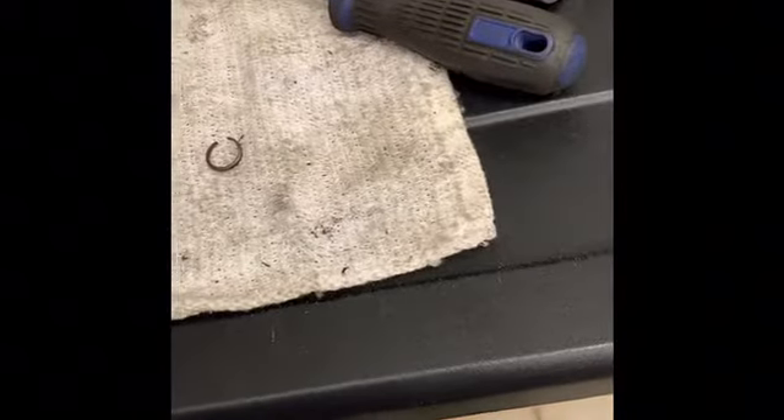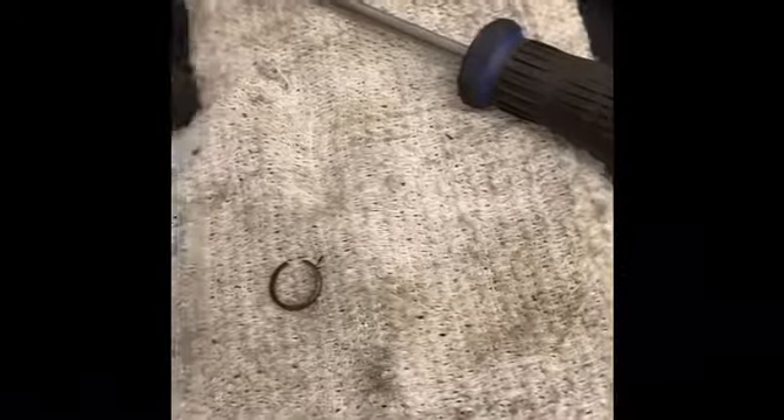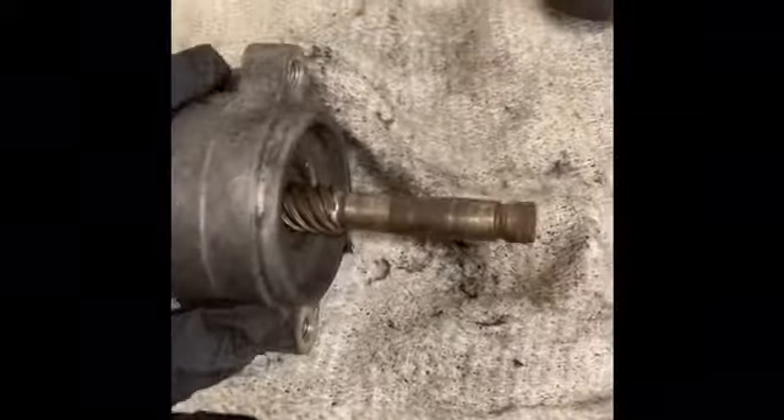There's a new one that comes in the kit — you can see here on the rebuild kit. I could not move this; it's supposed to move and pivot freely. This is the C-clip that comes in the kit, and this is the one I actually got out. I just put this in a vise upside down and gently tapped on that end — I didn't want to mar it up — and then pushed it out and was able to slide that off.